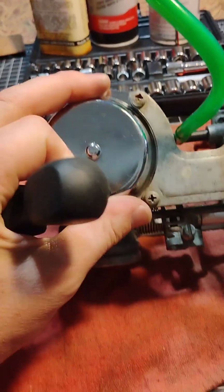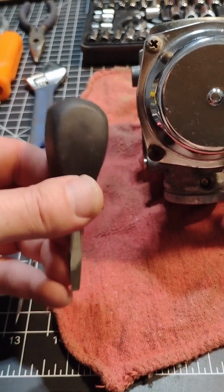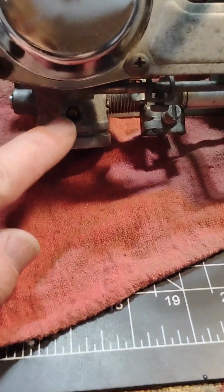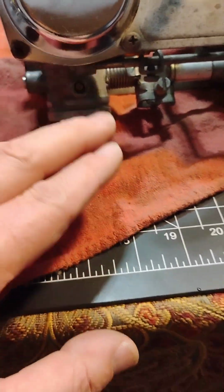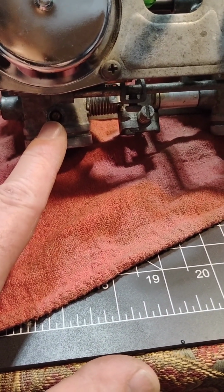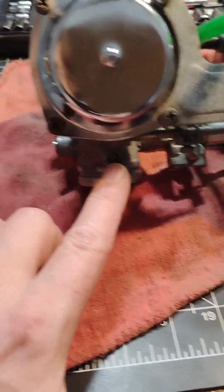Okay, so I just wanted to bring this out to mention that you will need that if you're doing a quick and dirty tune on the bike in the frame. I've even had to at times take a tweezers after I have it backed out with this and pull those out, make sure they're clean, make sure everything's moving good, and then put it back together. Again, you screw it down to 0 gently, and then I always start with 2 turns out. That's kind of the spec.